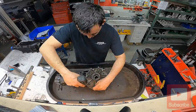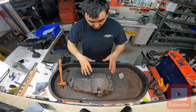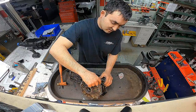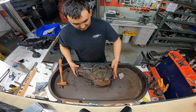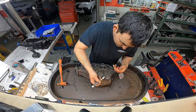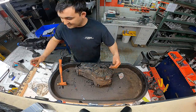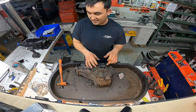I'm going to cut to a montage. What I found out through tearing many many of these apart is there's a little ear here and another little ear right there — use those two little tabs to pop this up and off. If you have any concerns about getting this back in the right spot, take a little paint pen and mark it for an indexing reference. However, this only goes in one way, so it is really really hard to screw this up.